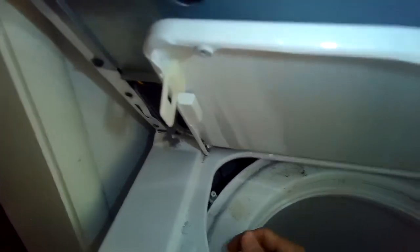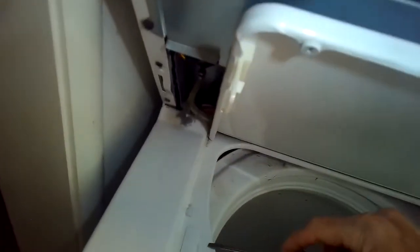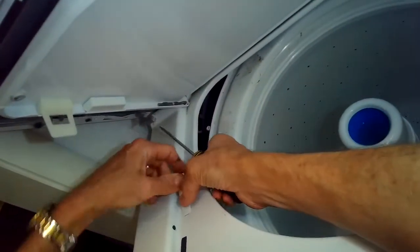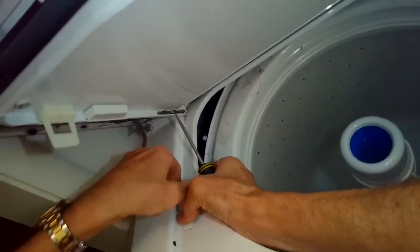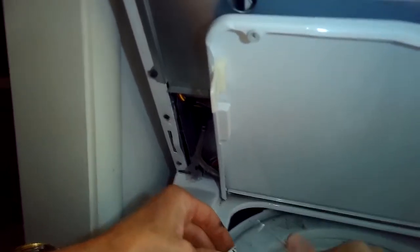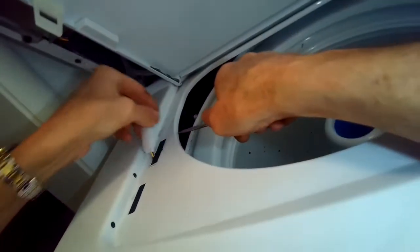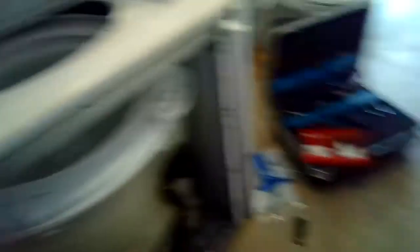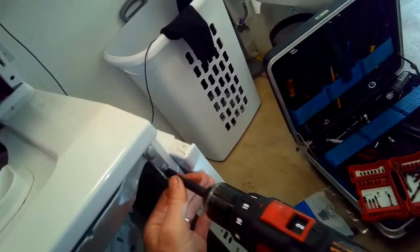Press in against this tab with my index finger, and at the same time from the top we're going to pry it up — the back part comes out first — so we pry that up with a standard head screwdriver and then pull it out toward the back of the washer. That undoes the front tab. The back tab is what really locks it in, so push in on that to release it, lift up the back, and the front will slide out. Push that down into the machine, then take off these two quarter-inch bolts in the front, and we can lift off the top panel.